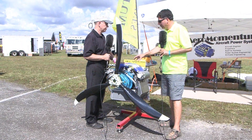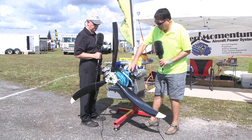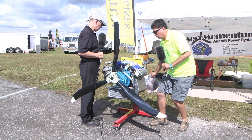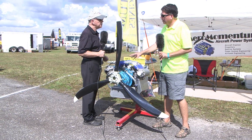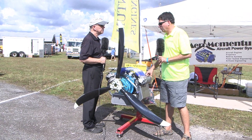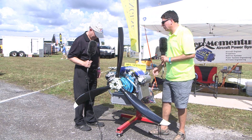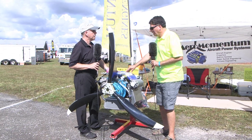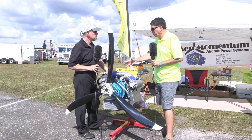The engine weighs 185 pounds. That doesn't include the propeller, radiator, cooling fluid, or exhaust, but the ECU and wiring are included in that weight. The radiator with all fluids adds 11 pounds, oil is basically a pound a pint, and the exhaust header is about 4.3 pounds. Anything that fits like an O200 — this will fit, within the same cowling.